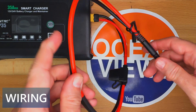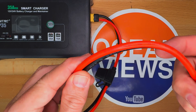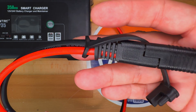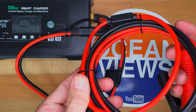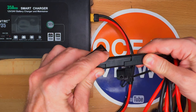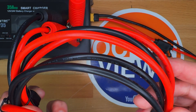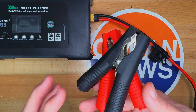I need to use this thicker gauge wiring because of the high amps from the charger, and also if you're going to be using a donor battery or jump starter. I suggest 10 gauge as a good thickness, and only use the length of wire you need. Be warned: if you try to use this high-powered charger on the existing thinner wires from the previous setup, you're going to blow the fuse. The battery tender company wires from the original video have a max of 7.5 amps, so anything higher will blow the fuse.